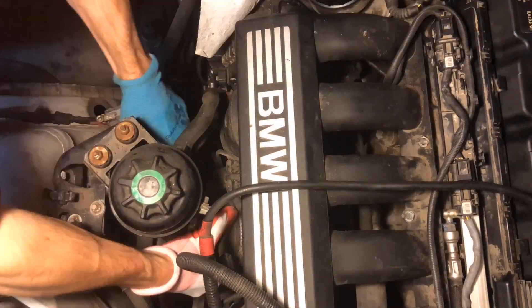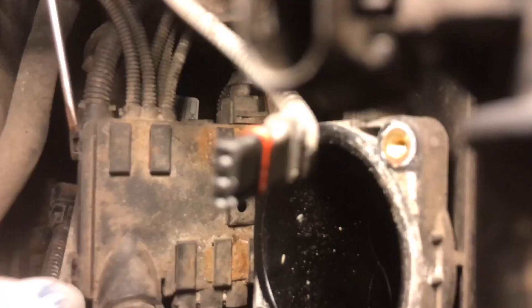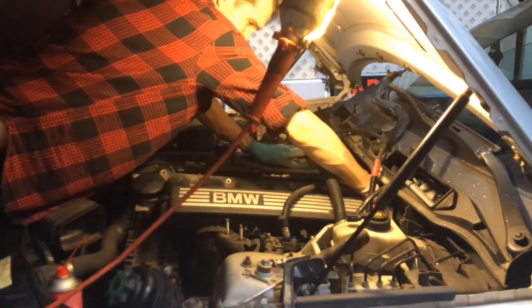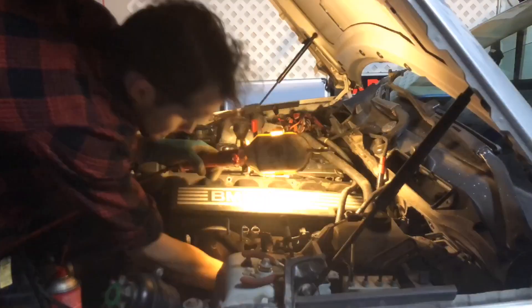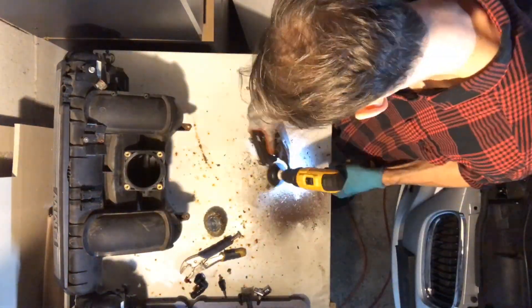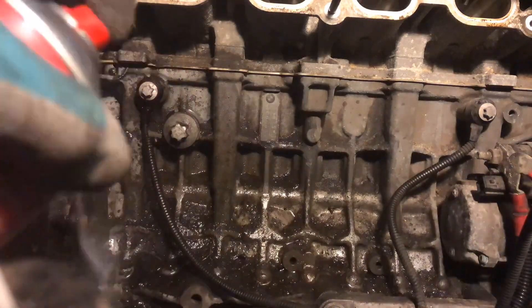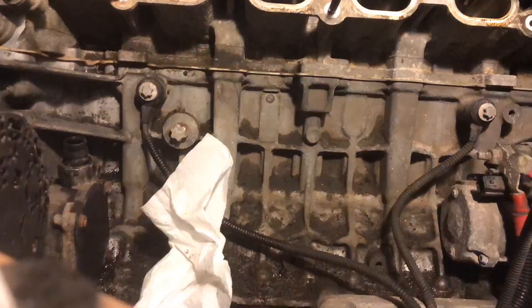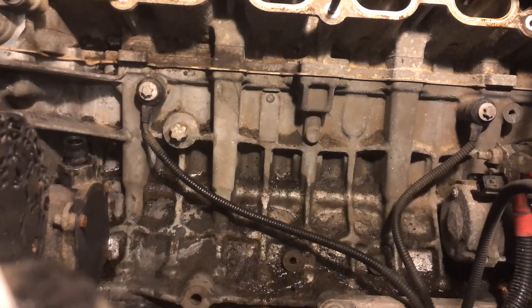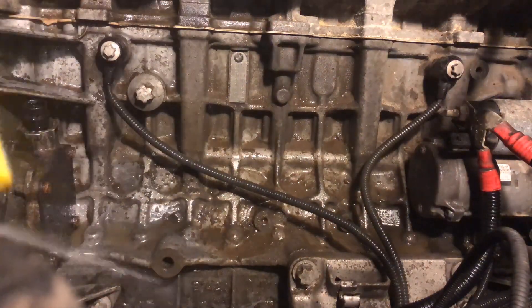In the next episode, I remove the factory intake manifold and replace it with the three-stage intake manifold off a 330i. Coupled with the right tune and some downpipes, this should get me close to 270 horsepower at the crank. I'm not really concerned about hitting a magic number — I just want the car to be more responsive than a stock 328. The engine is running again and we finally diagnosed the ECU issue as simply a missing ground strap. If you ever have an issue where your car turns on but something isn't quite responding, double-check that all your ground wires are properly in place.